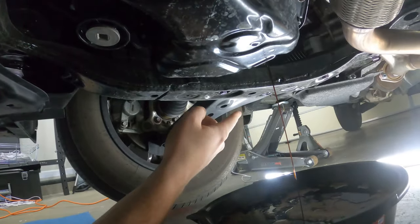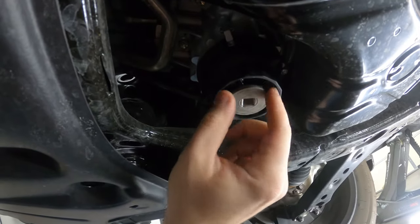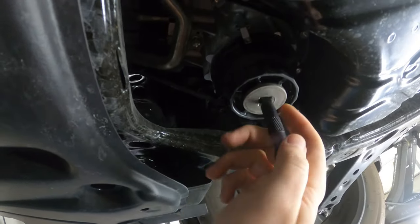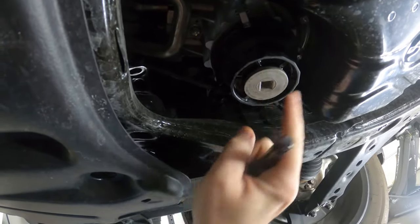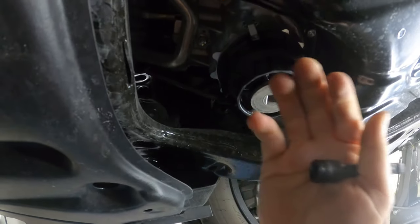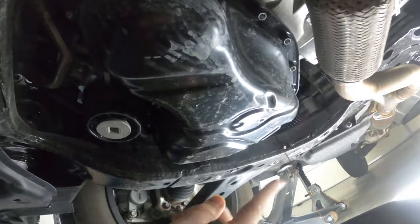While we're letting the last little bit drain out, I'll explain this. So this is the top cover right here — you'll use your ratchet and it'll go right in. This is my extension but your wrench will go right in and that's how you loosen it up. You'll break this loose and once you do, there'll be a little bit of oil coming out. Then you push that plastic piece that I showed you up in there and that's what lets all the oil drain down into your oil pan. We'll get started on this once all this stops draining.